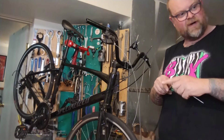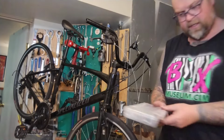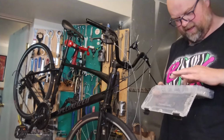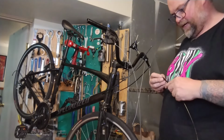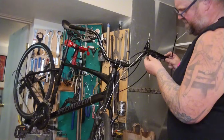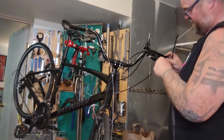Clean it out. Took the bench grinder, give it a little bzz, bzz, bzz. Make sure it's real flush and flat and no burrs or bits of the metal poking in. Pokey tool to clean. Onto my handy dandy little kit I've made of spare extra bits. We need to find a couple of brake ferrules. Okay, one metal brake ferrule. That one's barreling on there. Get rid of this front one. There's definitely a split on the bottom, so we can turn the barrel adjuster so all the splits line up. In theory.